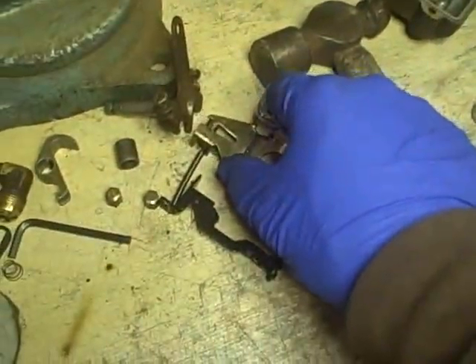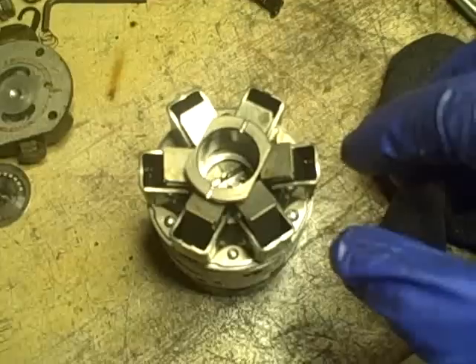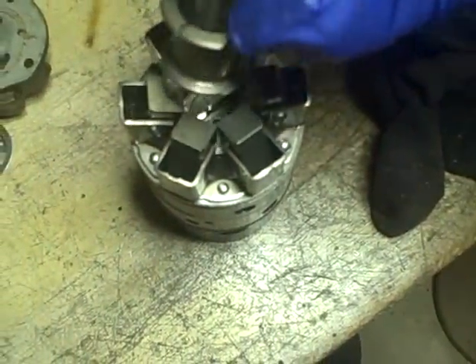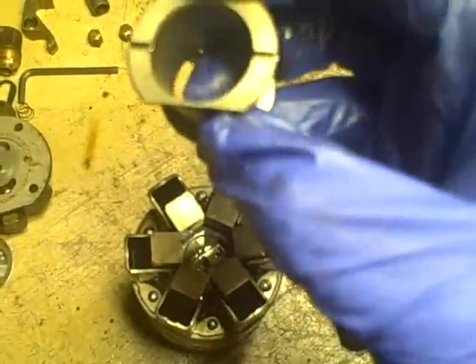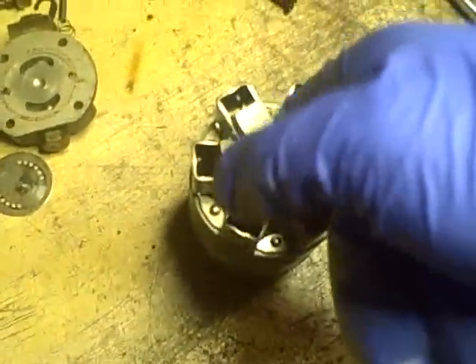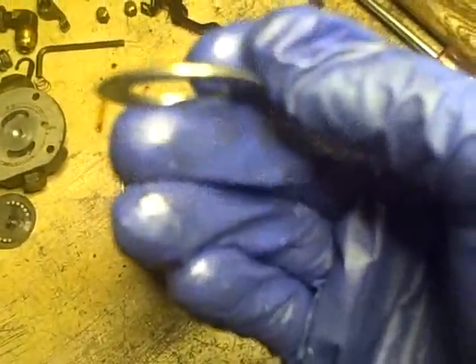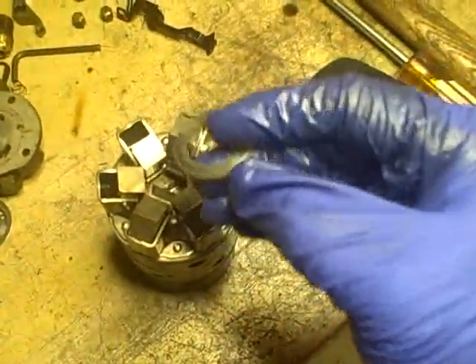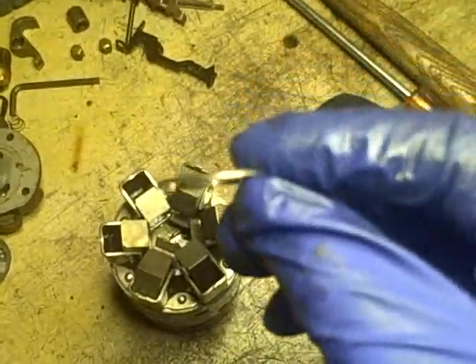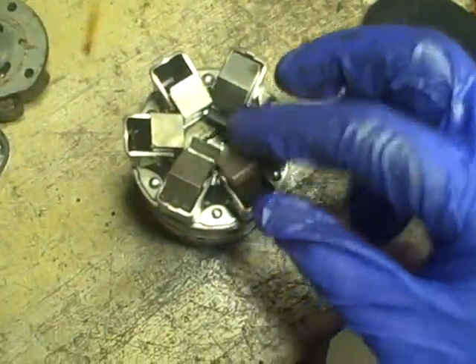This sleeve connects with this lever, and that lever with this lever, and that lever with this lever. So this looks like I could just pull it around like this and get the side with the glass faces up. And it looks like there's a shim here and here. That's a dished washer, actually - a dished washer facing up, flat side facing down.